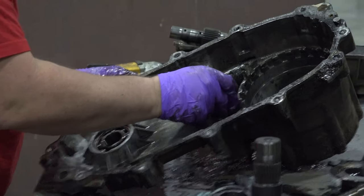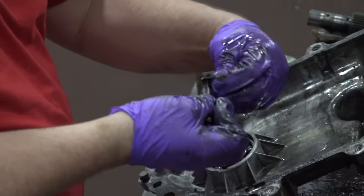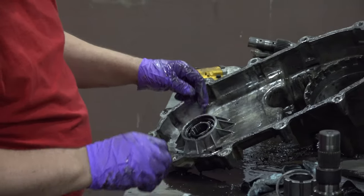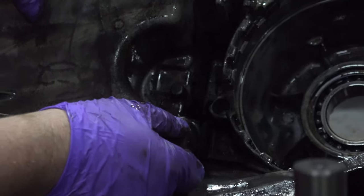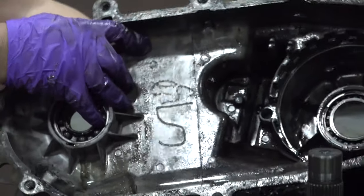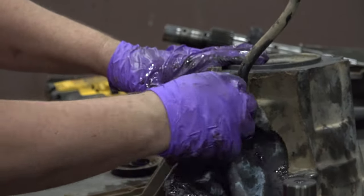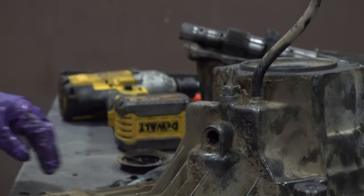I've got a clip in here that held all that together. Put everything back together so it's easy to find. Now, down inside here, I've got the detent ball that would spring against that edge right there. And that's what you feel when you can feel it shifting into place. So that detent ball is actually captured in that right there, which is your indicator for your four-wheel drive. That'll turn your four-wheel drive light on when you're in four-wheel drive.